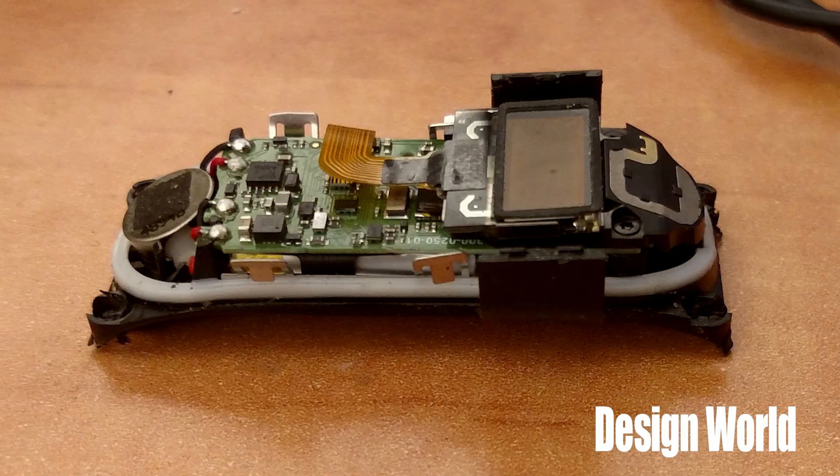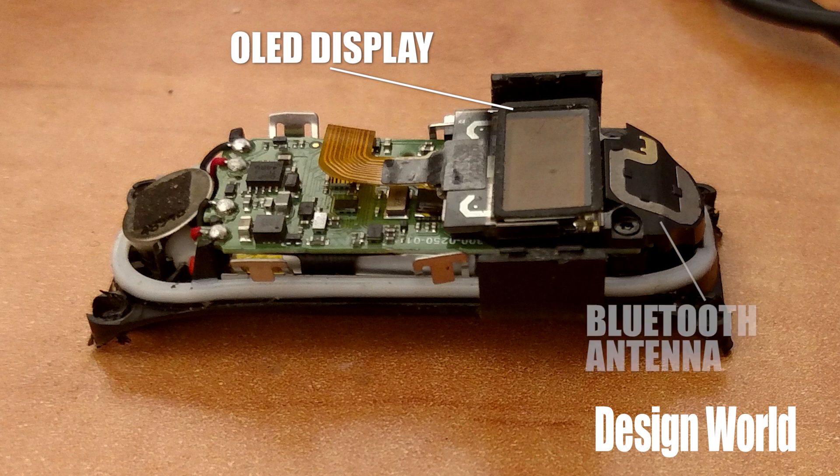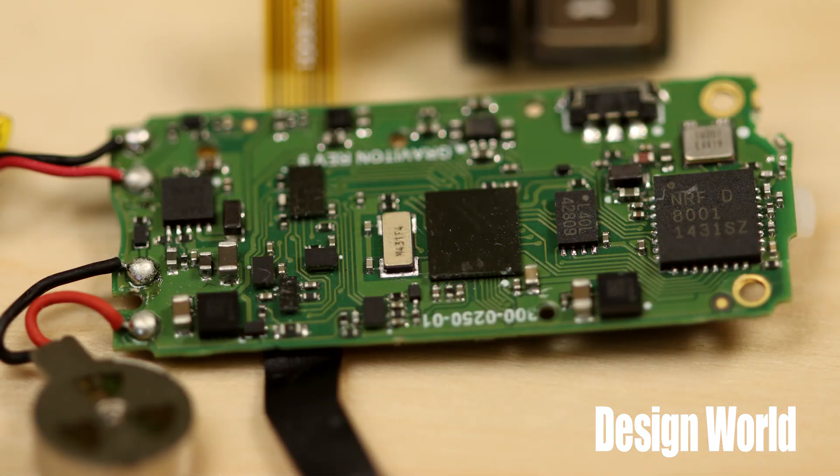The other side of the board is more populated and a bit more interesting. When you first pop the plastic cover off the Fitbit, that's the side of the board you see. The OLED display sits on top of it, pressed against a piece of plastic that both supports the display and doubles as an antenna for the Bluetooth connection. The metal bracket, which serves as a supporting frame for the recharger cable, wraps around and also helps keep the OLED readout stable. Adhesive attaches the OLED to the Bluetooth antenna assembly, which is held to the circuit board by two super tiny Torx screws. When you unscrew those, you release part of the antenna assembly supporting the OLED, and the rest can then be pulled off to reveal the components on the board.